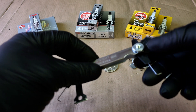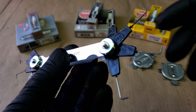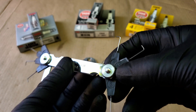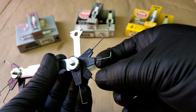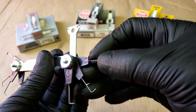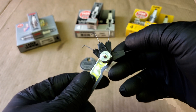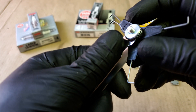The first gap tool has a variety of different sizes, each labeled with its corresponding gap measurement ranging from 0.02 to 0.04, with millimeter measurements on the opposite side. They can be a little hard to read unless you angle the tool. Different gap tool ranges are available, and these smaller sizes are mainly needed when an engine is modified or has a power adder.